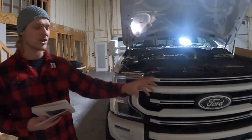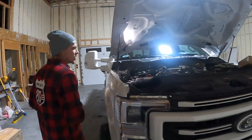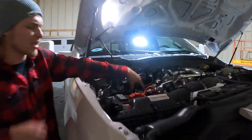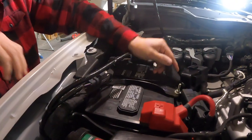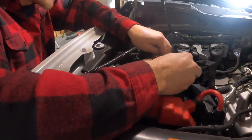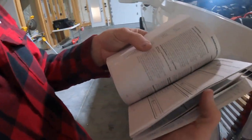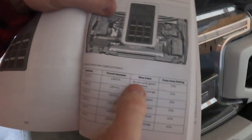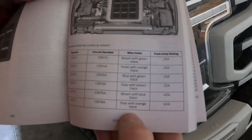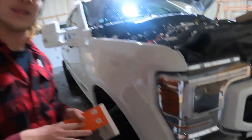We're going to remove the switch that comes with the kit and just use the one on the dash. I've already popped the cap off here. I'm going to flip it upside down and find our wires. If you're doing a different switch, go to page 551 or 552 in your owner's manual and it'll tell you exactly what wire color you're looking for. In this case, we're going to be looking for the gray with the orange trace, so let's get that done.